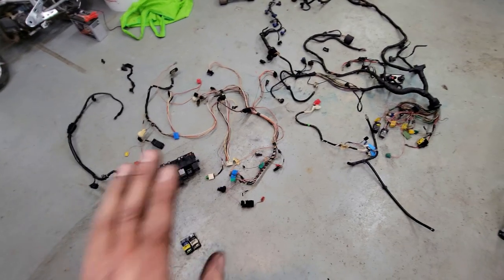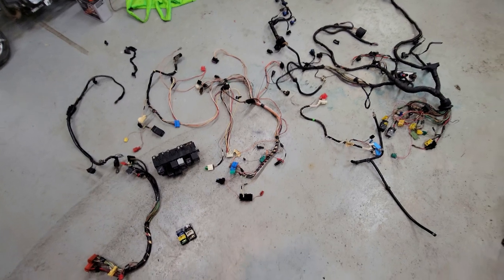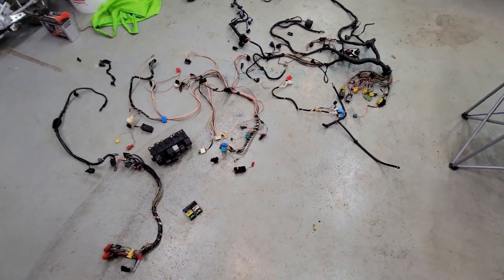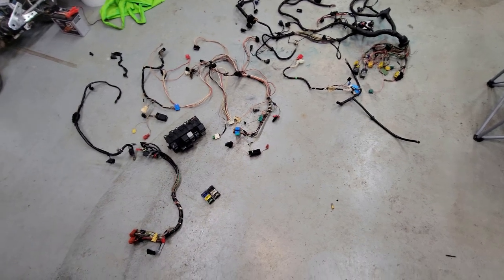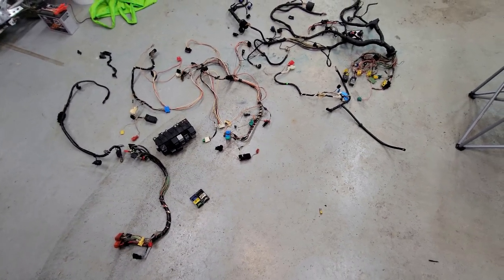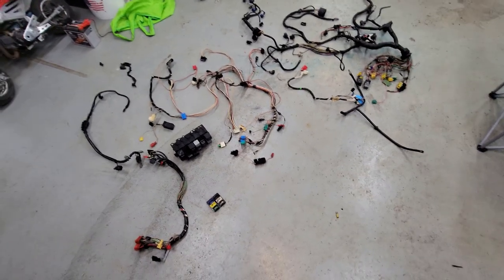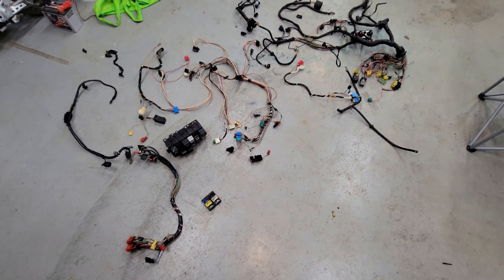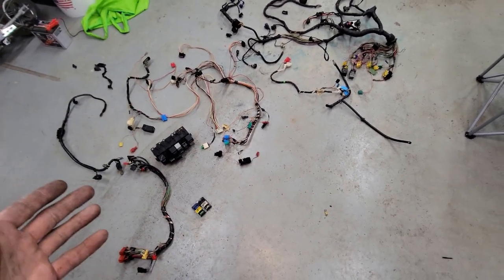More or less, we're going to use as much Mark III as we can, because I don't know if anyone's familiar with Westmoreland Mark I cars, Rabbits, Rabbit trucks — they weren't exactly known for being the best wired vehicles. Now, I will also concede that Puebla produced Mark III's — aka basically all of them — were also not wired that well. However, the wiring quality is better. It is newer wiring with better insulation on it.